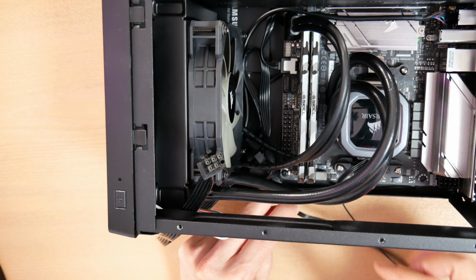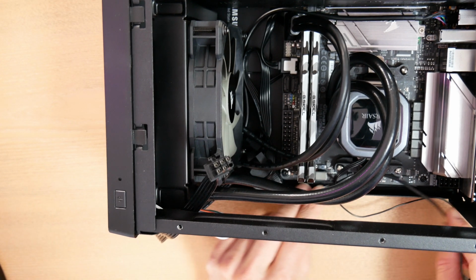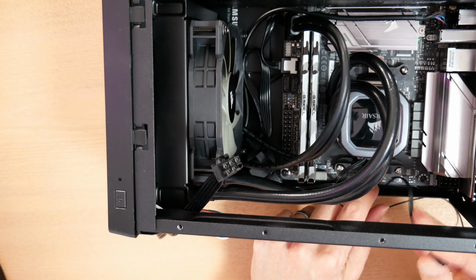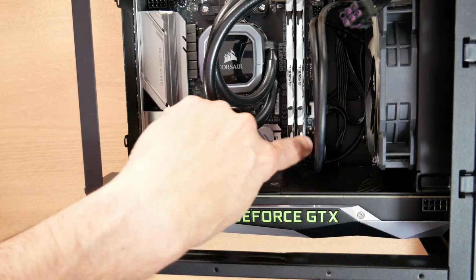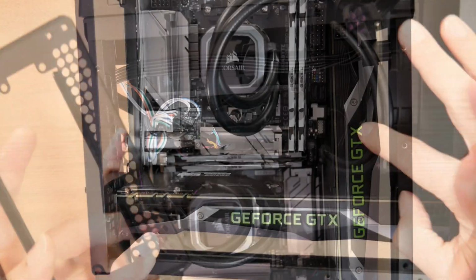Sometimes they recommend that you attach the pump to that, but I like to be able to control my fan using the CPU fan header, so it'll work just fine that way. My other CPU fan header is actually tucked right back here behind that USB 3.0 cable.